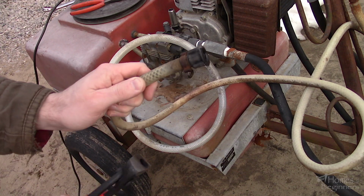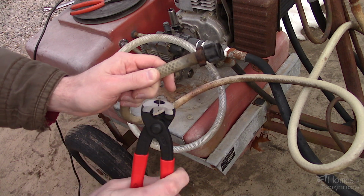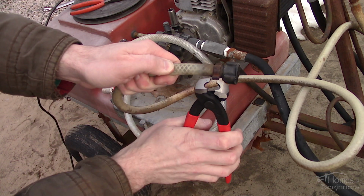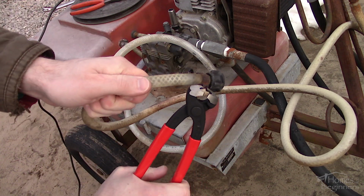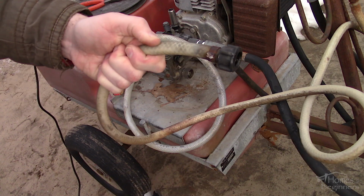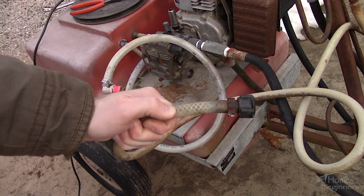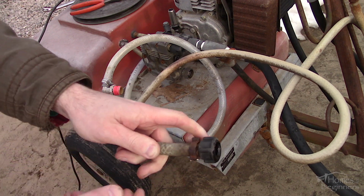And finally, the removal method I prefer. However, it does require an additional tool. These are pliers specifically designed for removing and installing these ear clamps. They have jaws specifically designed to cut the clamp. Side or bullnose cutters can also be used to cut the clamps, but they don't always have that rigid frame or enough leverage for cutting. After that, you can spread the clamp and remove. Then remove the hose off the connection.